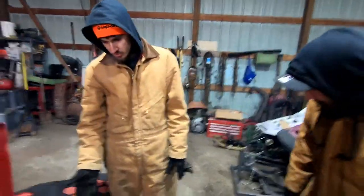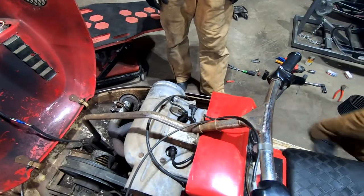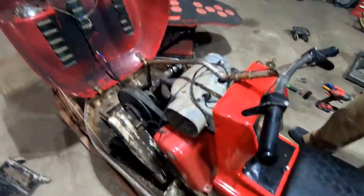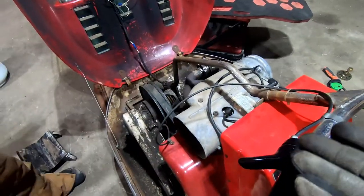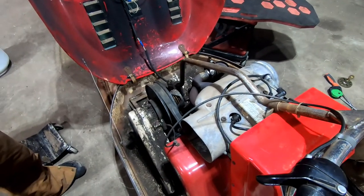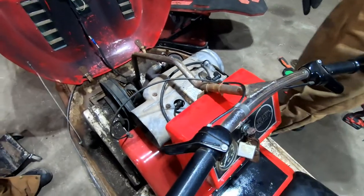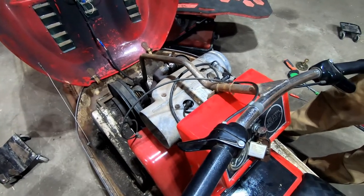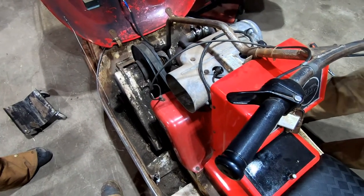This thing is running on one and a half cylinders — it's a 440 and it has no balls. It's basically 220 puppy huskies in there — little wiener dogs. We've come to the conclusion it's most likely a points issue on one set, or a condenser. Condensers get goofy and start acting up weird. We did have no spark originally — we cleaned them and it runs better if you clean them more, but that's just the nature of the beast.